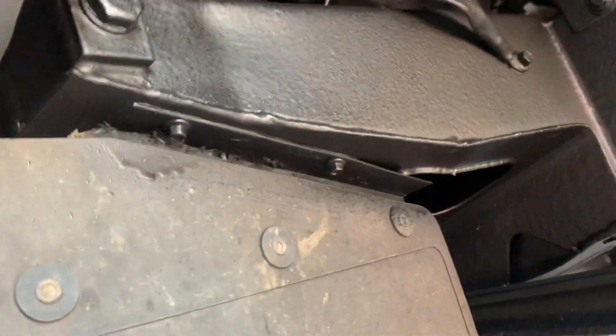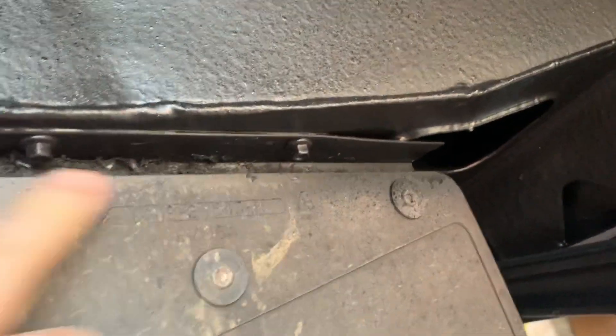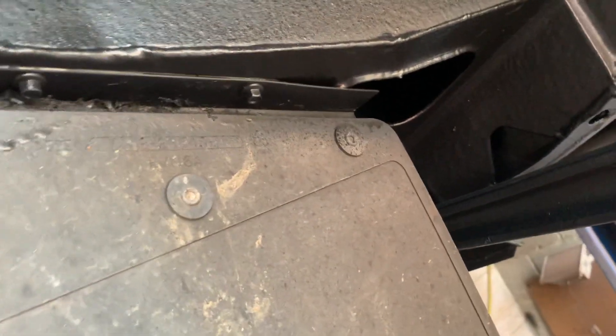All of these holes individually are all bare-metalled, and everything else in between we thin the paint just to check for any problems. So we don't bare-metal the whole thing — it is a compromise. Mud flaps and things are removed and then when we refit them we paint those areas back in as well. Obviously there are photos of those removed and then refitted. There are only plastic arches on the front of these Pumas but we paint those in and they look tidy.